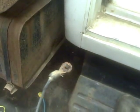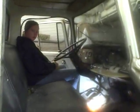Okay, well, Kayla was helping me out, and I think I figured out a problem. See this thing right here? Used to be attached to the frame. Yay! And now it's not. So, obviously, my ground was not being any good. So, I am going to get back at this when I have a multimeter, which is in the front seat of my sister's car. And so I can test voltage and I can test the ground.